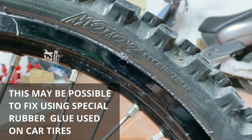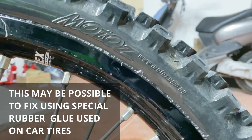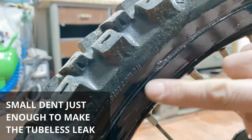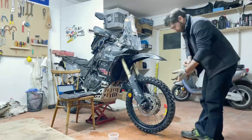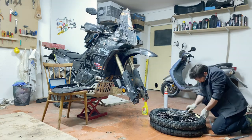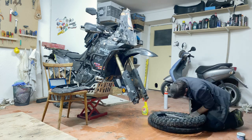This is the amount of leakage around the rim where it's not dented, and on this side is where the rim is dented. I can feel it with my finger — there's basically a hump around here. In order to fix this, I asked Punk Motto and he said: take the tire off, tap it back into place, and reseat the tire. So that's what I'm going to do now.